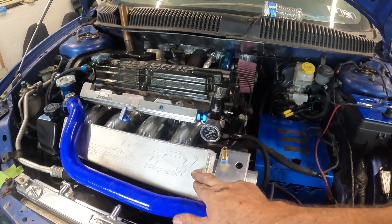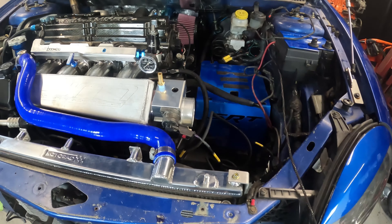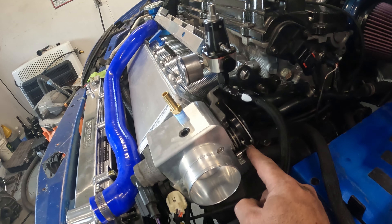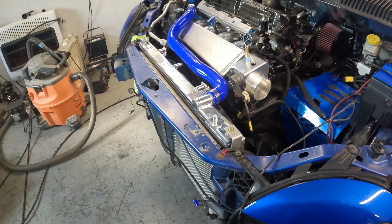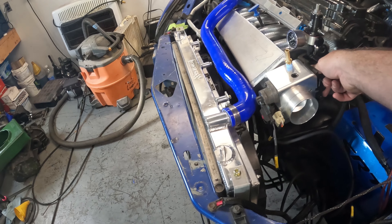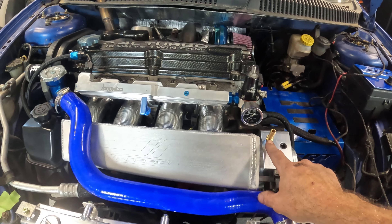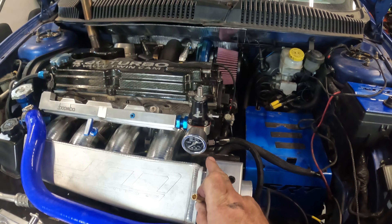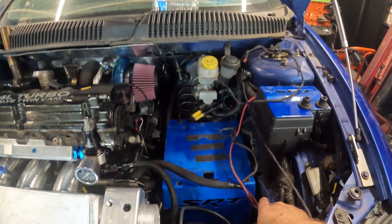A lot of our problem is the 70 millimeter throttle body - this is the first time I was able to install one of these. I did have to take the little lead ball and hold it with some needle nose pliers and grind the edges because it fit really really tight into the throttle body. So now there's a little play there but it seems to be working. Another thing I'm going to do is hit the hardware store and get a 90-degree fitting that I can use to kick this back, because I'm going to wrap it around and down when I mount my coil pack back over here.